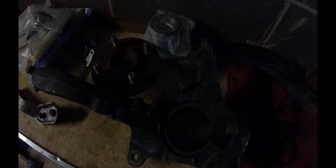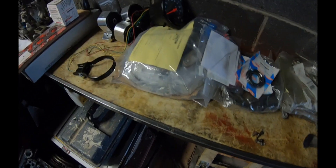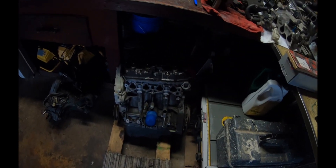I'm so excited — Christmas came early today. I got my eBay exhaust in. I'm going to open this up and show you guys all the piping that comes with it. Also, I took some time messing around with these steering knuckles — these are CRX SI steering knuckles. I was able to get the old ball joint and old bearings out on both of them. Pretty easy process — you just remove the snap rings and hammer it out. I did receive the last of my parts for this swap, so it's basically on the machine shop now.